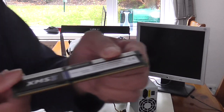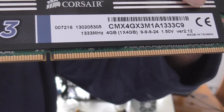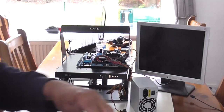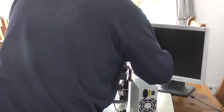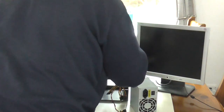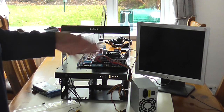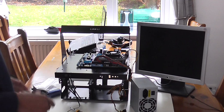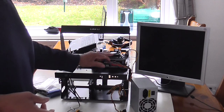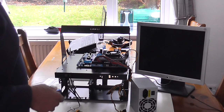So you can see, I'm not putting any hard drive on it yet, but then what I'll do is I'll look up that RAM and we'll get some more of the same, if possible. If not, then I'll probably just have to get a whole new set, all the same RAM for the quad channel. It's just for the CAS latency, because obviously the CAS latency is an advantage. So there may still be some about, but it may not warrant what they might want for another two of these DIMMs, if they're still available. It might be worth just getting the newer brand, the newer latency.